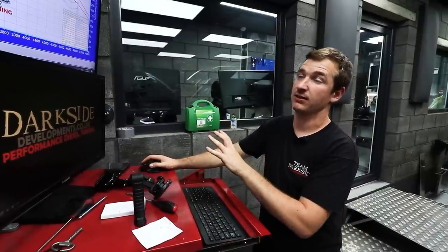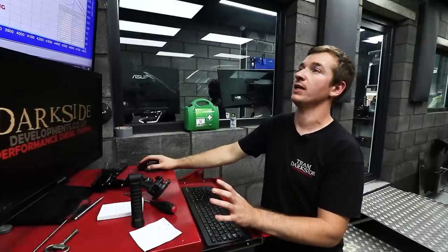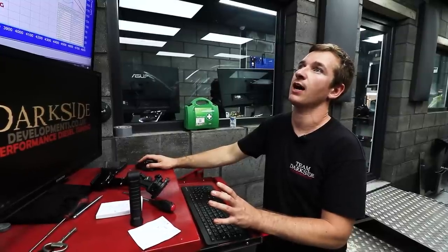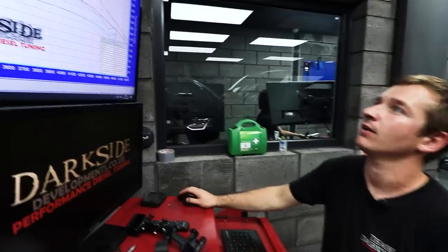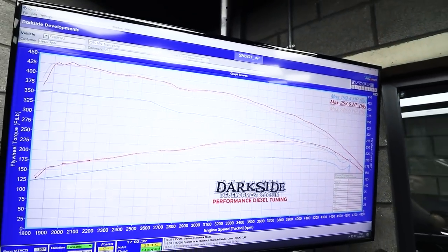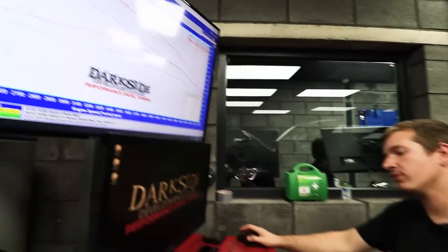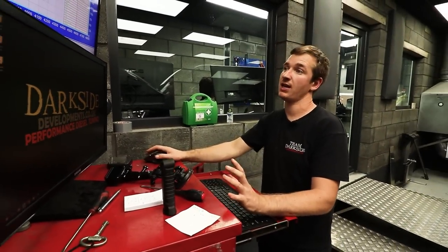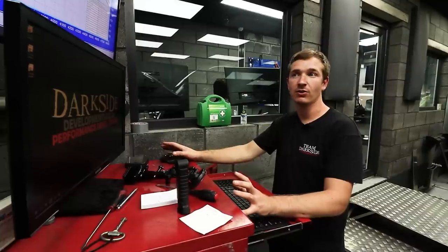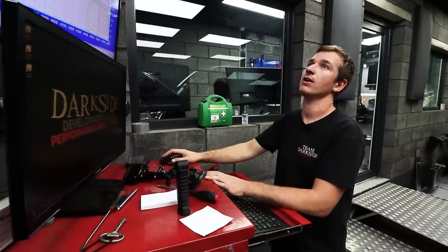So 425 foot-pound, 258 horsepower — this will be a rocket on the road. But we need to see what the EGTs are like when we've got it back out. I think if we're selling this to customers, we're probably going to be saying the mid-240s are where we want to be if you're keeping near to standard emissions equipment — so that's a more realistic estimate, around 240s thereabouts. If we get 258 and it's nice and cool on the road I think that should be fine. If you're removing the DPF because you're in a country where you can do that without any problems, I can't see any reason not to push it. But it might just be getting that little bit too sooty for the DPF at that level.